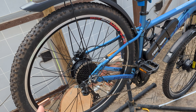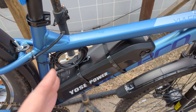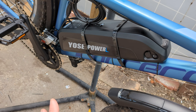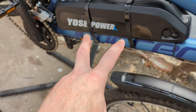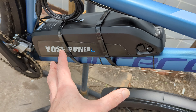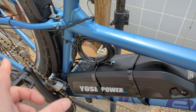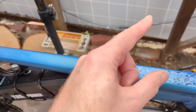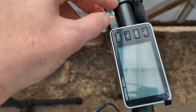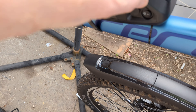I think the only other thing I needed was a big adjustable spanner. For the Yoss Power battery, because this was a medium frame, I couldn't get the two screw holes where the bottle holder is to be in the right place to fit the battery. So I've got one screw hole in there and just a couple of big cable ties holding the battery on. Then it's just a matter of routing wires to and from things — wires from the motor, wires from the controller. This kit came with the nice big controller. The battery has an on-off switch, which is nice.